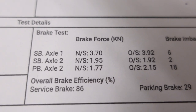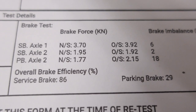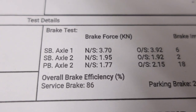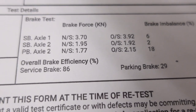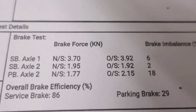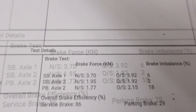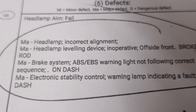There's a 6% imbalance on axle 1, 2% on axle 2, which is very good indeed. 18% on the parking brake — I think the tolerance is 20%. All those are good anyway. So, the broken rod — let's see where we are with that.